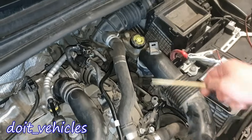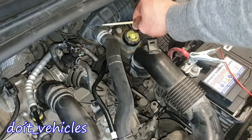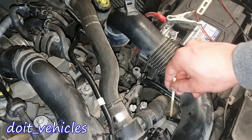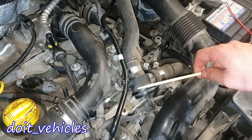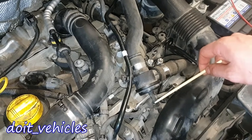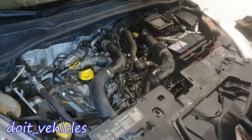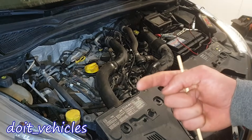Now finally, we've got this air duct here — it's basically a shortcut of air from this first intake pipe, right before the air filter, and it goes next to the throttle body here. It looks like we've got a check valve here which is vacuum actuated. So yeah, that's pretty much it about all the components on this engine. Take care, drive safe, and I will see you in the next video.